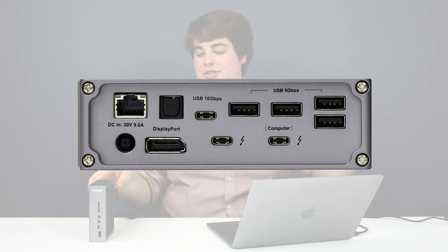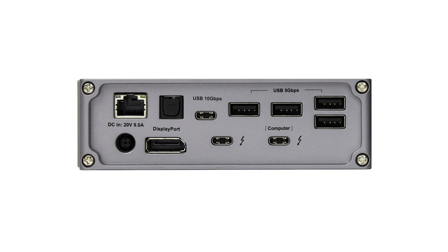On your TS3+ itself, each of the Thunderbolt ports provides a different amount of charging. The first port — the computer port — provides 85 watts of charging. This is functionally identical to the new Apple charger, the one that provides 87 watts to your computer, so you shouldn't notice a difference. If your computer does not require 85 watts of charging, this should not be a problem. If your computer requires more than 85 watts of charging, this will still charge your computer, albeit at a slower rate.